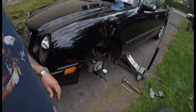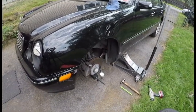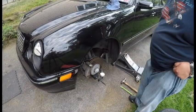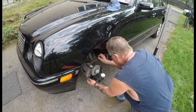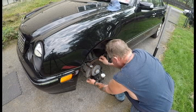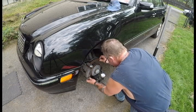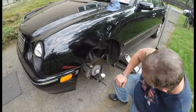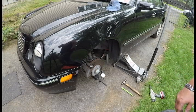You're better to have a little loose than not loose enough for lubrication to take place. When you have hard contact, your bearings are going to wear out prematurely. So right now I pulled this wheel off, used a screwdriver and slacked up my brake caliper. I put the dial indicator right where the mounting screw is that holds the caliper on. I zeroed it out, and pulling, I get about four thousandths of an inch of play. So I probably got a total of about five thousandths of an inch of play in there. I'm going to use a chisel now, get the grease cap off, and then recheck it on the spindle itself.